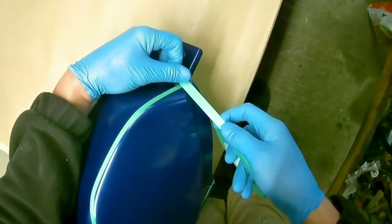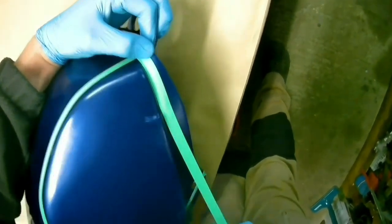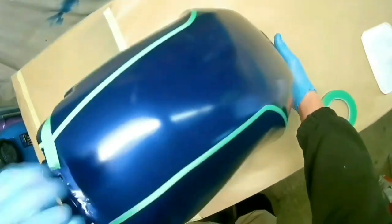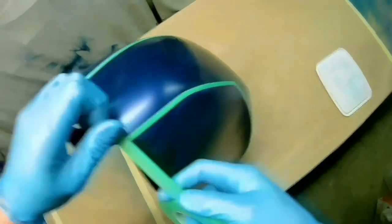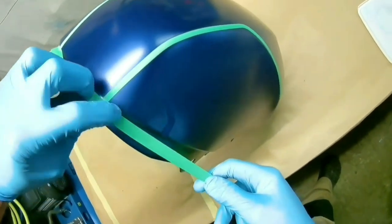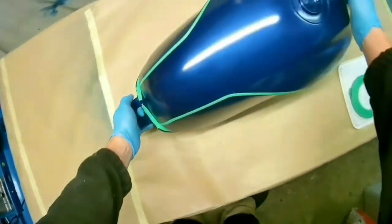As I said, it's sped up one and a half times. You can see I'm using a thicker tape here — that gives me an easier line across a straight section with less masking to do afterwards. It's easy to do with thicker tape on straight lines, but if you try corners with thicker tape it's much more difficult, so thinner tape is better for corners. When masking over, you need enough width for your paper to mask to, so it doesn't bleed underneath the tape through to the paintwork on the other side. Anyway, I hope the video has been of use to somebody. Cheers, take care, bye-bye.